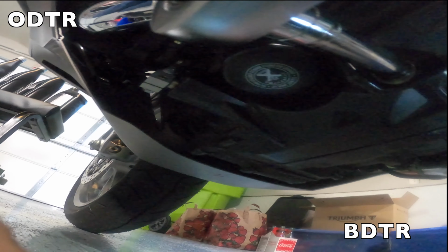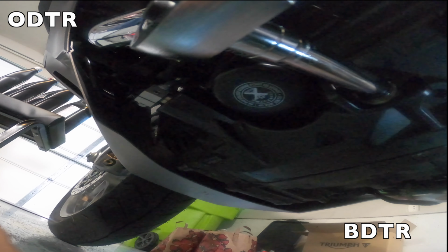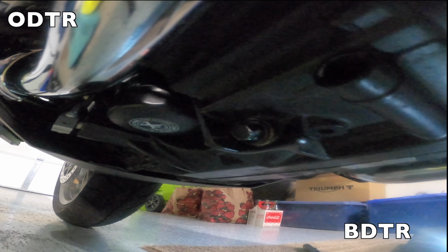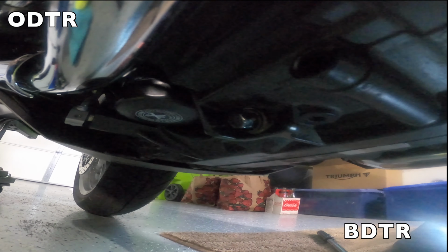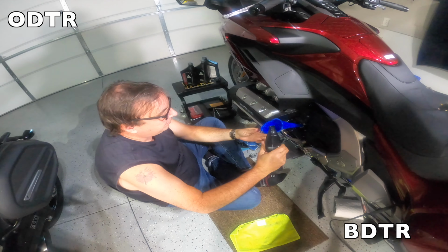Alright, so the oil dripping is done, and I just need to hand tighten that oil drain plug and then tighten it up. Should only take a minute or two. Okay, so I am not using a torque wrench, but this just needs to be snug, and we're going to snug it up right now. That's it. It's snug, so now we can add the oil to the bike. I waited over an hour for that to stop dripping too. So the first official oil change continues. Okay, we're pouring in our first quart of oil.